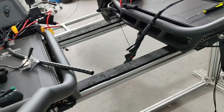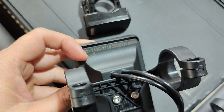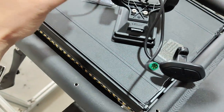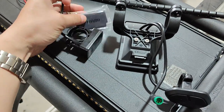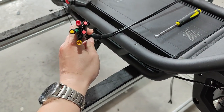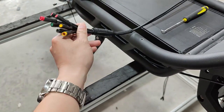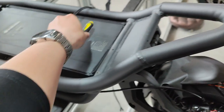For the update, you need a new dashboard — it comes with an 'A' in the series numbers. You need an NFC unit purchased from the dealer, which comes with two cards. You also need a main wire that has an extra connector for the NFC to plug in, and a hook tool for the cables.